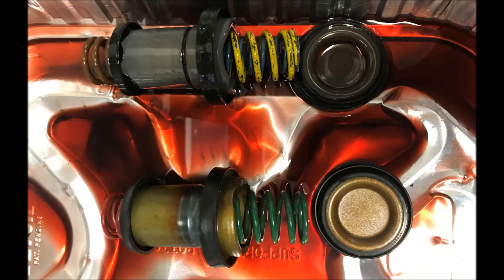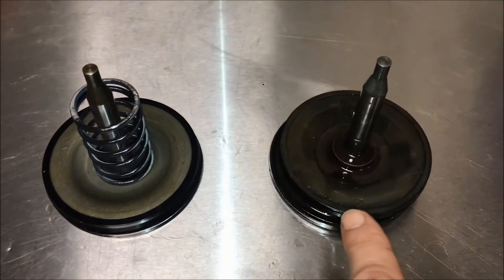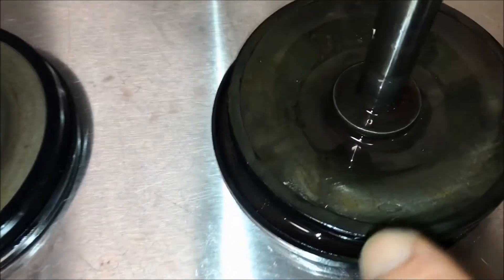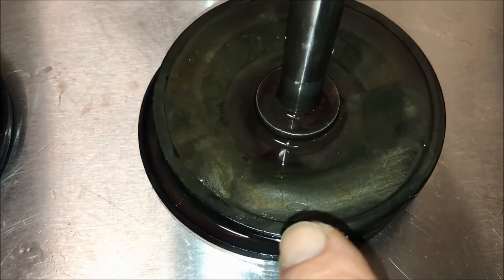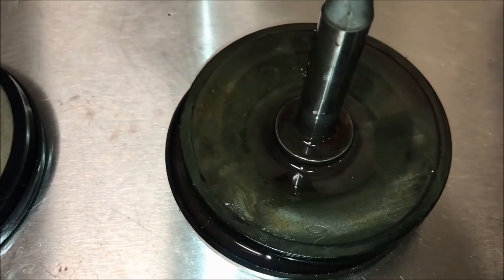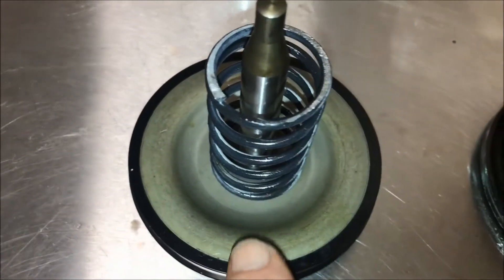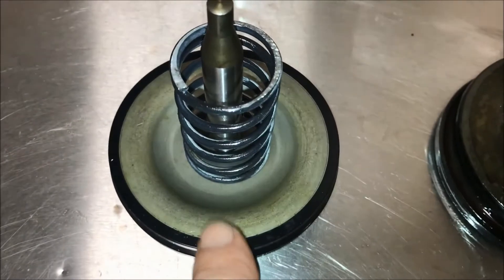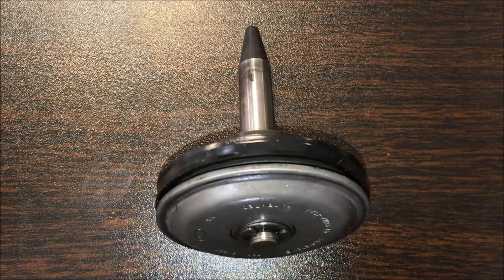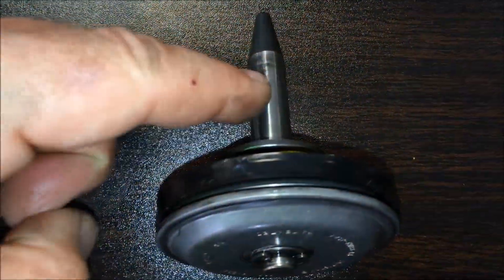Although you can change the one-two shift accumulator without pulling the valve body, you can see with the old accumulator that was pulled there's a significant amount of friction material on it. I've wiped some off just to show how much settles on this. It's a pretty easy one to change. Here's a new one with the old spring on it — I'm going to be installing this next.